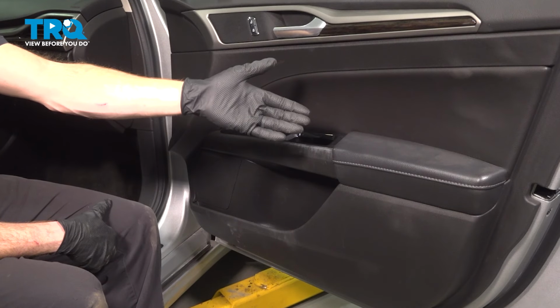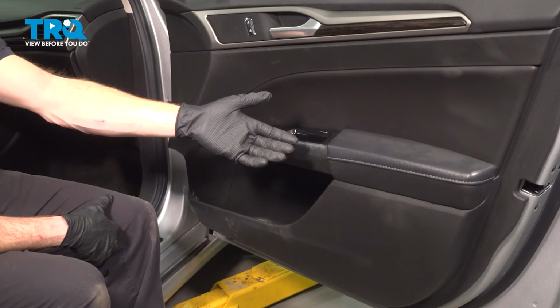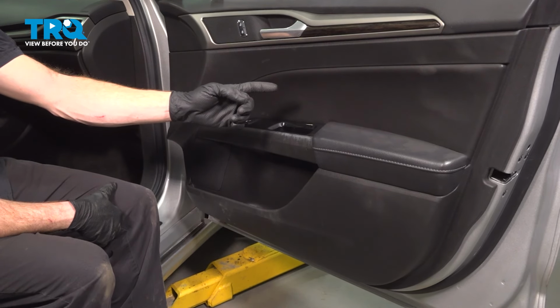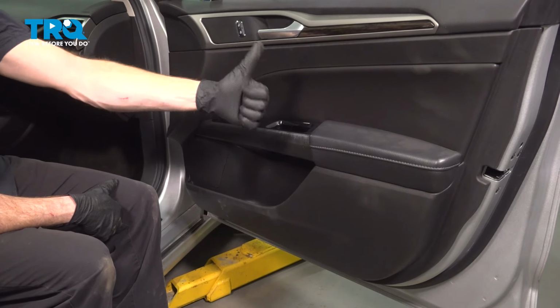Okay friend, we finished our installation. We've tested the functionality of the door handles and the door latch to confirm they work properly before installing the door panel. The next thing you need to do is go ahead and put the key in the on position and test the window functionality, confirming it makes its way all the way up and down as it should. Aside from that, thanks for watching.